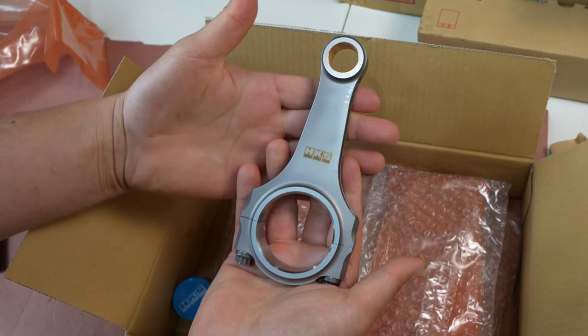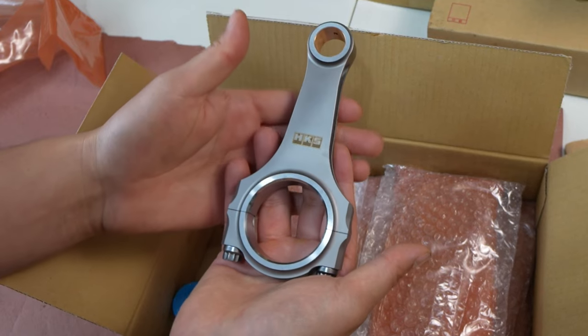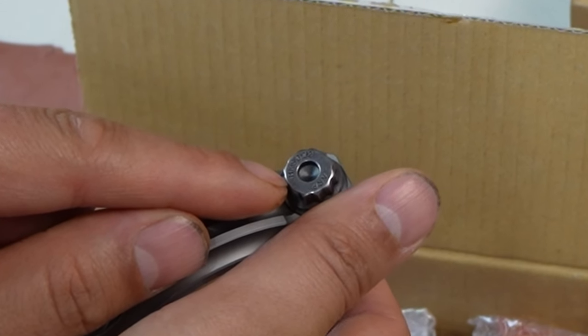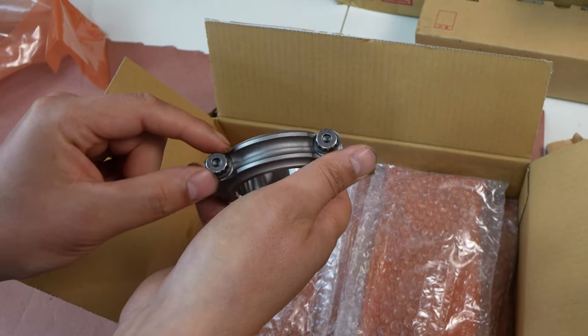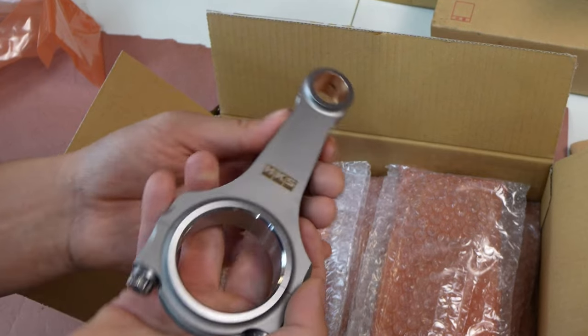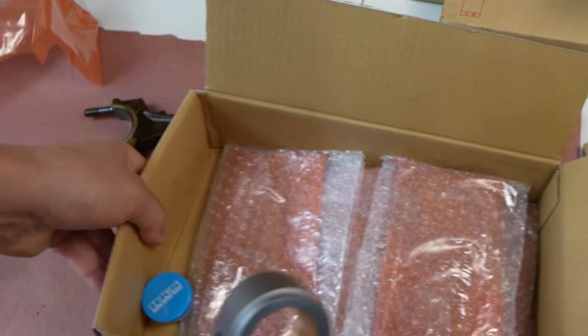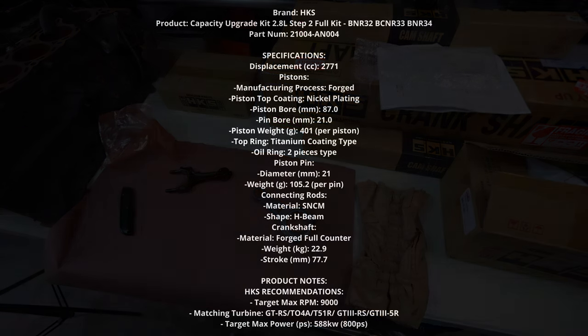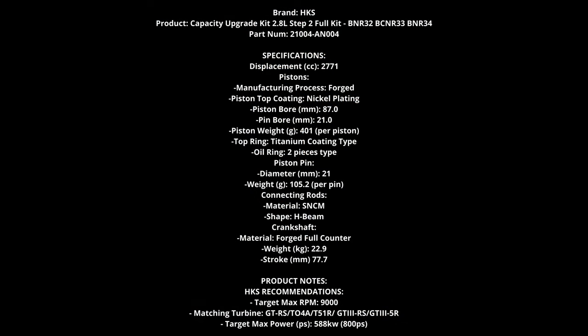Look at this. Look at that freaking HKS conrod. Holy crap, this thing is beautiful. There's ARP studs in the bottom. And this thing is beautiful. This whole stroker kit is designed to rev up to 9,000 RPMs in conjunction with the HKS higher lift valve springs